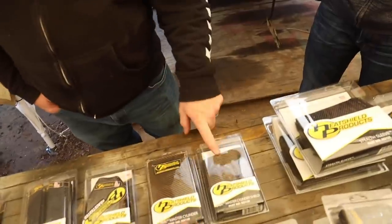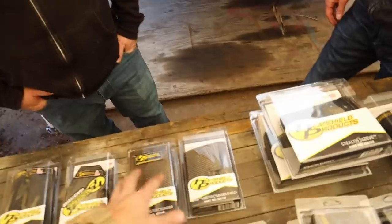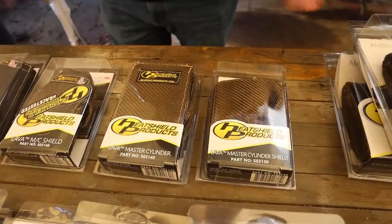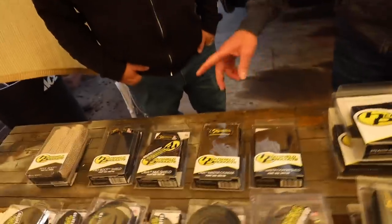Everything in that engine bay is very hot and tight, especially up top where heat rises. A problem we're definitely going to run into is the master cylinder. These covers wrap around it — either a velcro closure or a wire closure with button head rivets. They make specific sizes for specific applications. We're going to try the Wilwood one first. They make them for Wilwood, Baer, and GM stock master cylinders.